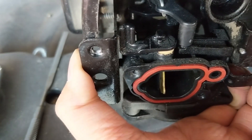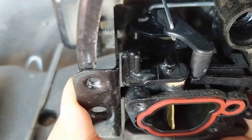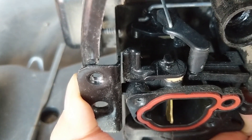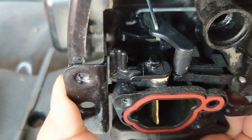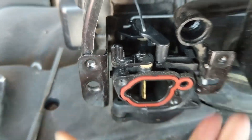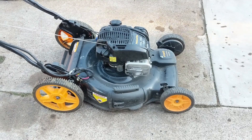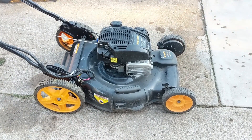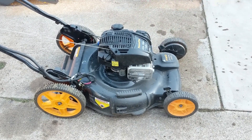I'm at the point now where the metal bracket is seated up against that little plastic piece. What you want to do is look straight down and you want to see a gap between the choke lever and the metal plate. I've disconnected the choke spring just to show you, but now it will not stick — there's no way for it to rub up against that metal bracket. I'm going to put this back together and fire it up. Now that we've filed down that choke lever, it won't seize in the open position — it should choke itself and then open once the engine gets hot.